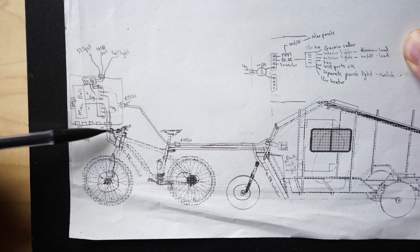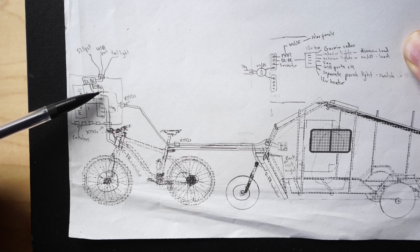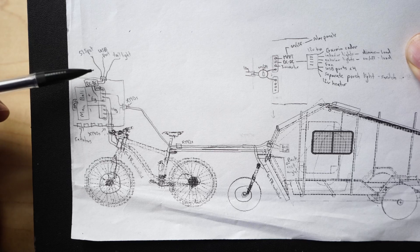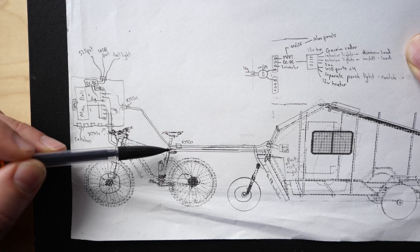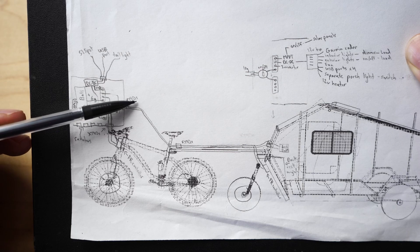Inside the cargo bay box I'll house my main battery. From the battery, the main leads will be 6-gauge stranded copper wire going to positive and negative bus bars. From the bus bars, I'll run a circuit to a 72-volt to 12-volt step-down DC-to-DC converter, which will power the front headlight — I'm going to use an S1 Spot from Baja Designs, which is amazing. It'll also power a USB port to keep my phone charged while traveling, and the rear taillight on the bike for when I'm riding disconnected from the CyberDrop. The next circuit from the bus bars will feed into an XT90 anti-spark connector.